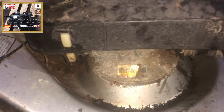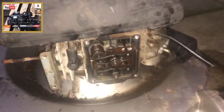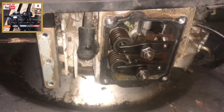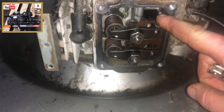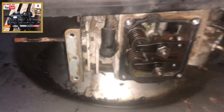Now the chap said he thought it did have compression. I rigged my compression tester up and it hadn't. But not to be deterred with these overhead valve engines, I whipped the valve cover off and noticed that the valve stems — both valve stems — were actually not seated in the recessed area at the back of the head.